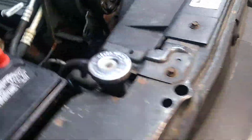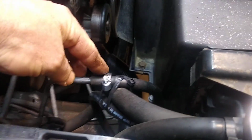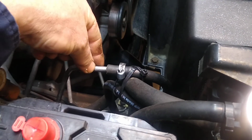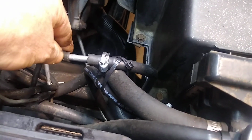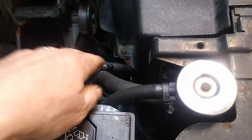The whole installation is kind of makeshift in my opinion, but I didn't want to get into totally replumbing that. So I went back with the same approach they had, which is just disconnecting the line that usually goes to the radiator, and it's rerouted with these hoses that go down to the oil cooler, back up, and feed back through the radiator and then ultimately back to the transmission. So yes, I do like zip ties for certain things. For that application, I felt comfortable going back with the way it was. It's been that way a long time, and I didn't want to get too involved in replumbing that.